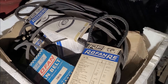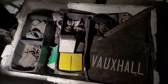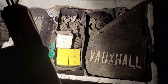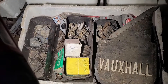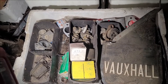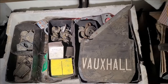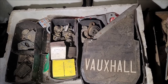It's not the most expensive part to buy new. I actually had to move two boxes, but I guess I had some luck here. Because there are some thermostats - they do appear to be used maybe, but I can test them. What I want to do is to find an 80 degree, because I found out that the one in the car, although I changed it myself a lot of years ago, it's an 87 degree. So even if it worked, it would open a little later, and I do think 80 is what it's designed to be.